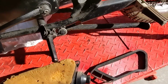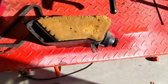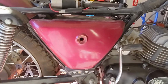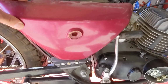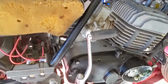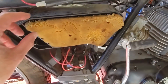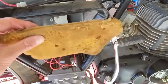This is the air cleaner assembly, and this is the front of the air cleaner. This attaches to the inlet side of the carburetor. All right, I've got the right side cover just loosely assembled to get into the airbox and air filter area. Typically this filter is held in and the cover is held on by a long bolt that comes all the way through the airbox. It's not here. The filter element is just a piece of foam. It's about a half inch thick.